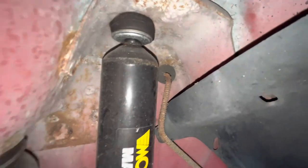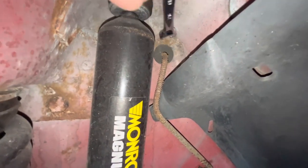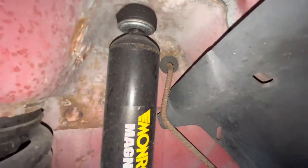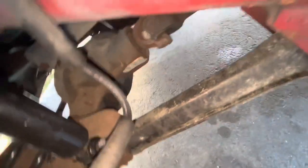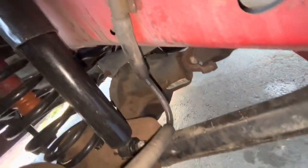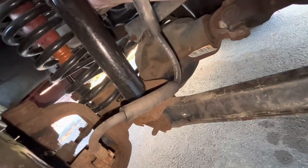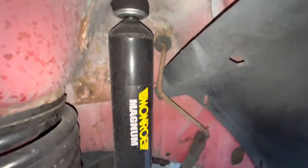There is a grommet or a washer — it's really not that tight of a grommet because you can see right through it — but there's a grommet right there. Then it just comes down, gets attached right here with a star bolt, and then there's currently a plastic hose. That's what I want to replace with stainless steel. I want to replace the hoses just because I don't know how they are, but they do tend to collapse. Then we'll just replace that going into the brake shoe.